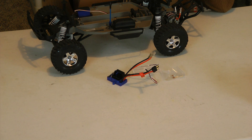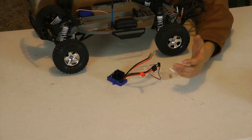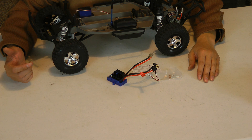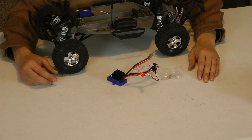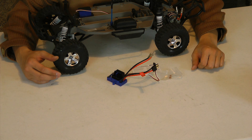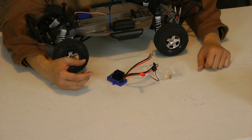You may have seen an earlier video of ours where we removed the stock ESC. What we're doing today is going through the process of installing the stock ESC. The reason we're installing a stock one is the original went bad, so we have to get a replacement. This would have been a good time to upgrade to a brushless system, but because we want to do some more tests with it, we ended up getting the stock ESC, the XL5.